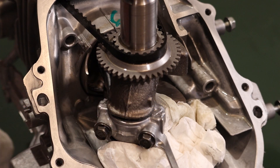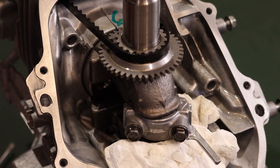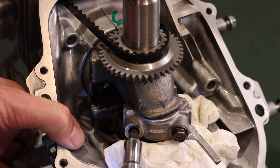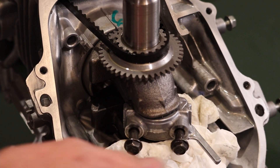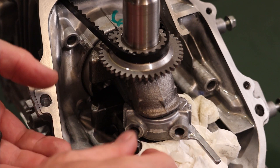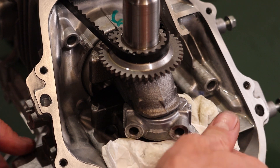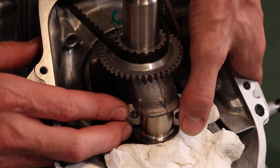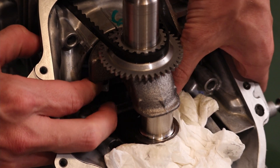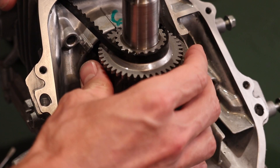At this point, we can simply rotate the crankshaft to about bottom dead center. We can then remove the two bolts holding the rod cap on — make sure to completely remove them. They are unique to this engine; they're the only two bolts that fit and don't interchange with anything. We can now push the piston all the way up to top dead center and rotate the crankshaft freely.